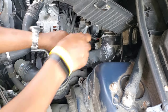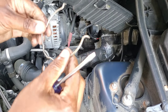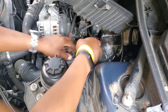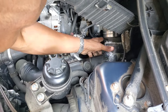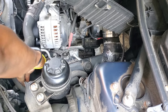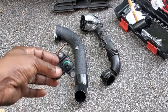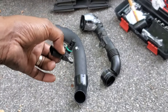Partly because of my anger that BMW decides to use such cheap plastics. I'm going to remove the first clamp at the base by the front of the engine bay — this is a basic flat-head screwdriver clamp. BMW uses these clamps a lot and they're actually pretty good. Next at the top there's a clip — press it out and move it up and out of the way. You don't want to lose this because it's going to anchor the new piece in. With that clip off, the whole thing should just come right out. I got the sensor off the old pipe with two Torx screws, and I'm going to screw it onto the new pipe.